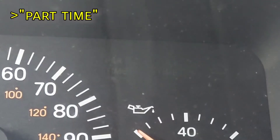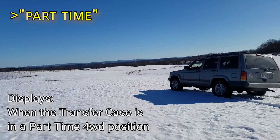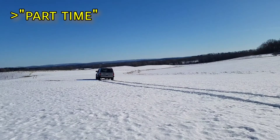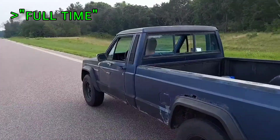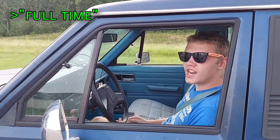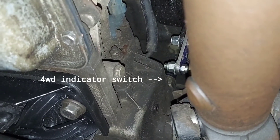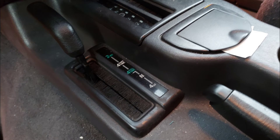In the top right, we have the four-wheel drive and upshift indicators. Part-time displays when the transfer case is in a part-time four-wheel drive position, either four high or four low, meaning the front and rear wheels are physically locked together and forced to turn at the same speed. This mode should never be used on dry pavement or high traction surfaces, as it might cause drivetrain binding or wheel skip. Full-time displays when the transfer case is in the full-time four-wheel drive position — if you have this option, it's best used for snow or icy environments, as the transfer case allows the front and rear wheels to spin at different speeds, meaning you can drive on any surface. The sensor for both indicators is located on top of the transfer case. If the indicator lights don't work, as they often never do in XJs, this sensor is the most likely culprit. You don't need the four-wheel drive lights to use four-wheel drive — just looking at the position of the lever is all that's necessary.